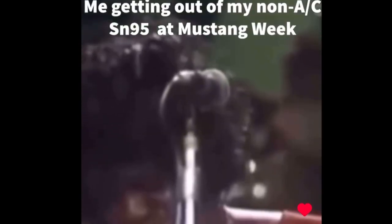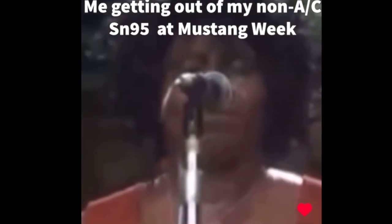On paper, it sounds nice to have a 2,500 pound SN95, but as a casual driver, you're going to hate it. 90 degree summer days without AC or radio is going to suck. So here's my thought. If you want to do simple weight reduction mods like a tubular K member, sure. But if you want to gut the interior of the car and add Lexan windows, you better be about that life. What I would do for all SN95s is a tubular front end just for weight reduction. For '94 and '95 Mustangs, I would do aluminum heads and the tubular K members and control arms.